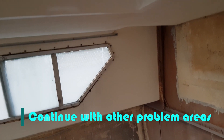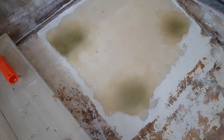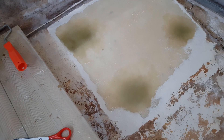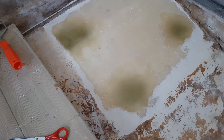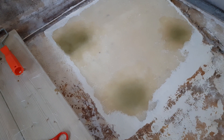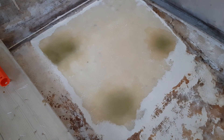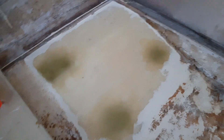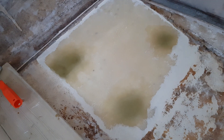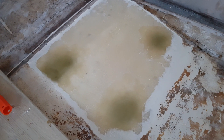I've done a lot of sanding and glassing today. We've done this section of the inside of the hull — a few bits of osmosis which were ground out and tidied up, and I've just glassed them in with about nine or ten layers of glass, so they're now beautifully flat and they can be sanded in tomorrow once they've set up properly. Really, really pleased with it, but that little section there is about a ninth or maybe even a tenth of the area that we've got to do. That was four and a half hours of sanding.